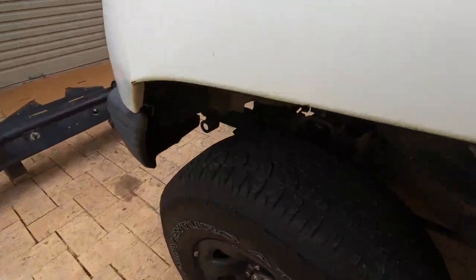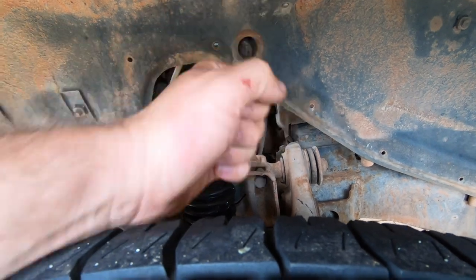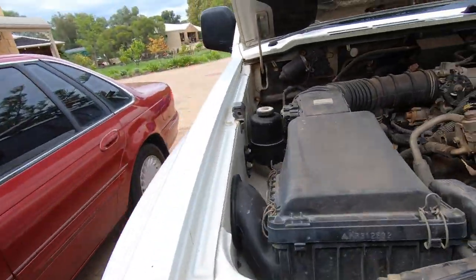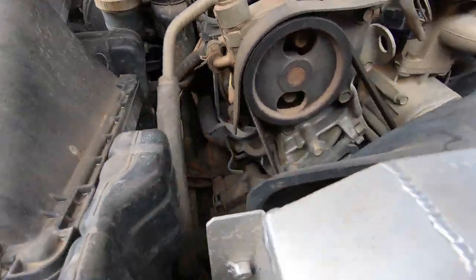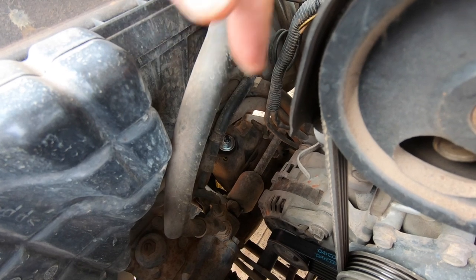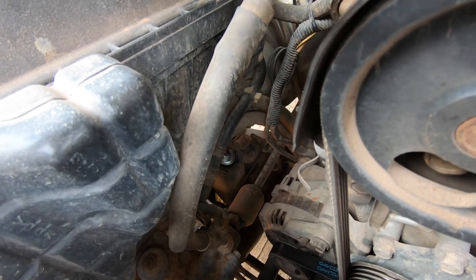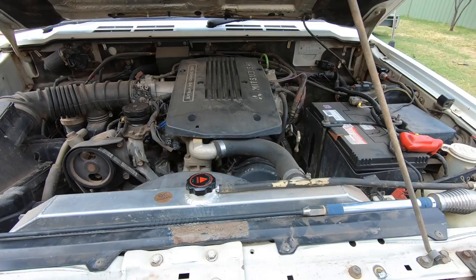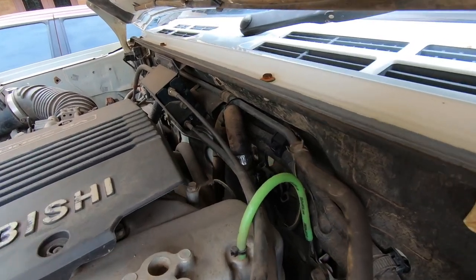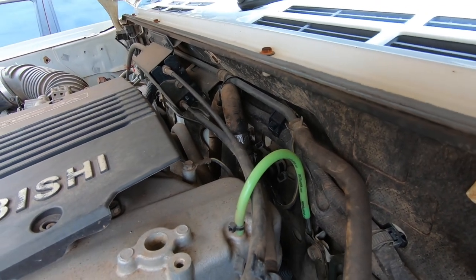Other things to consider: we've got brake lines here — these are quite good, they're coiled up inside there so you can literally just pull them through. The steering column shaft is hard to see down there, but we may have to undo the clamp where it's splined and slide it back a little bit on the splines. With a one inch body lift that's not an issue; with two it possibly might be. Heater lines — with a two inch body lift I remember on my shorty I had a drama, but this car has had the heater core bypassed because it's leaking, so no issue there.